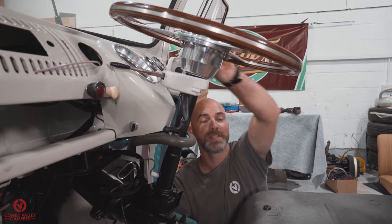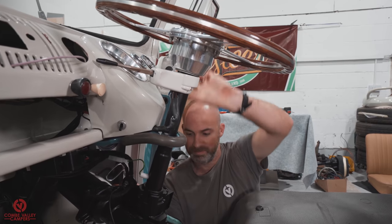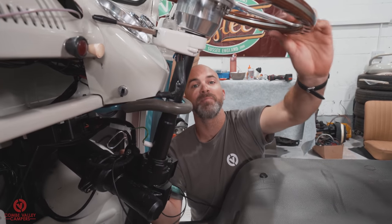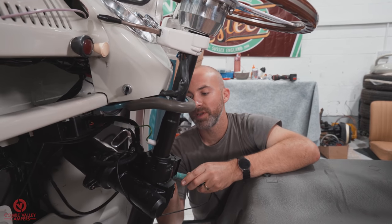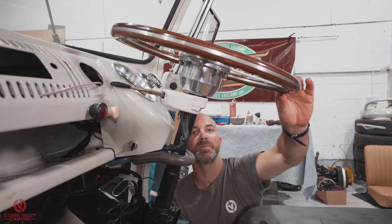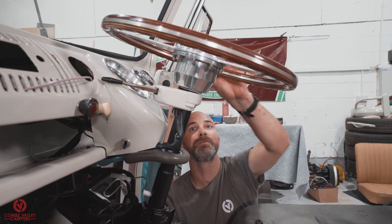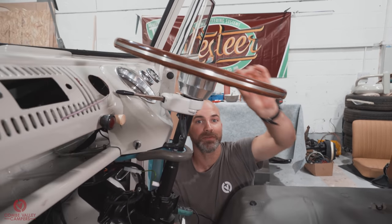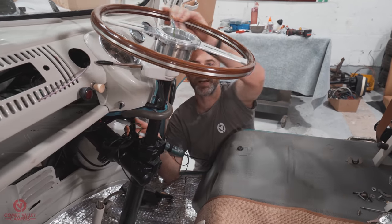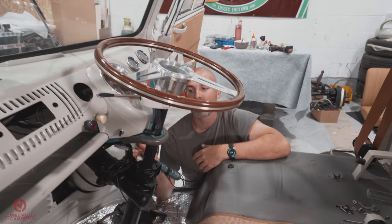We've got the steering wheel moving left to right, and there's a bit of tension up there, and that's just tension through the system. Obviously, I'm fighting against an unpowered motor there as well, but the moment I apply the power, you can hear the motor click on, and you can almost see that's so much easier there, and that is the power-assisted steering in, well, just working. And I take the power off, you can hear the click, and then the power assisted steering stops, and there's way more effort to put into the steering.